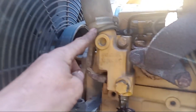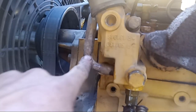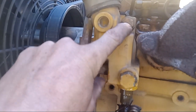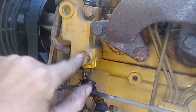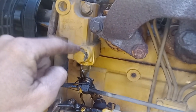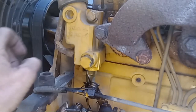That's our top radiator hose coming down. We have a bolt here, and this is your bypass valve — this tube running in the side here has a bolt behind it, so this bypass valve is going to have to come off as well. You're going to have a bolt behind the bypass and a bolt here — those are the two bolts holding it on. Once your engine is cooled down, take this bolt out first and that is going to shoot out antifreeze like a rocket, so stand back. A drip pan probably won't help much because it's going to squirt everywhere, but you can put a couple pans on the ground to try to capture a majority of it.